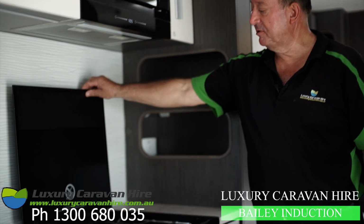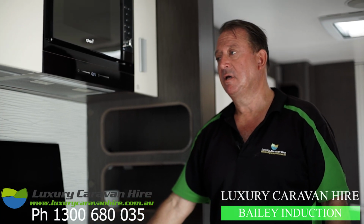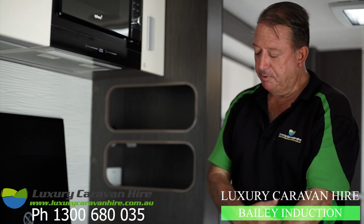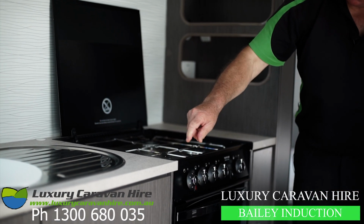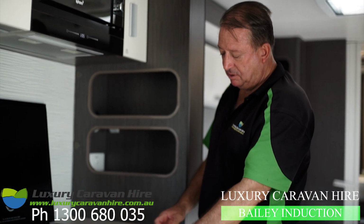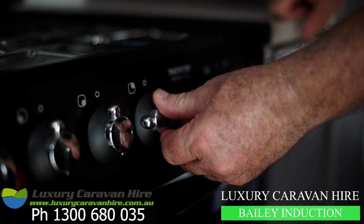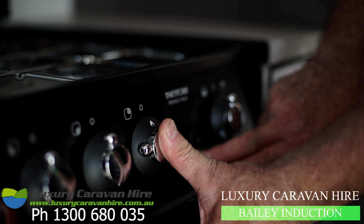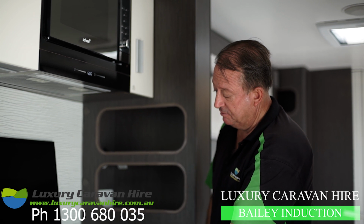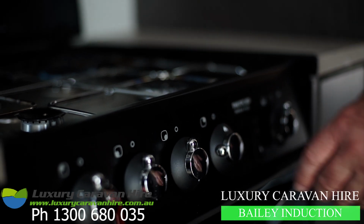First thing, let's lift up this lid. You want to have that open so that you can have access to the 3 gas burners and 1 240 volt electric burner. Whenever you operate the 240 burner, you'll see that the light comes on when you're plugged into 240. For the gas, it's as simple as turn the gas bottle on, push the button, hold it in, turn the knob, press the igniter. Once you've got flame, keep holding the button in, then you can release and it will continue to operate. When you're finished with it, of course, always turn the gas off.